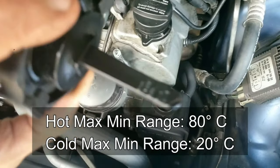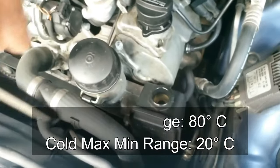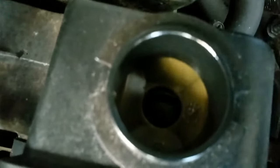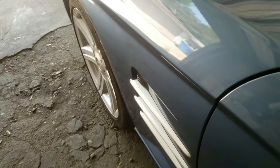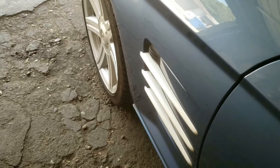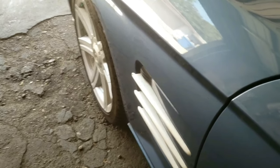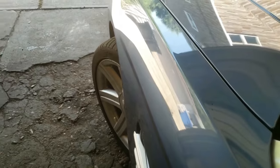First check your gauge and see if you are low, then add power steering oil and turn the tires to see if the bad sound or hard steering goes away, or if you have a leak. Do the simplest stuff first before removing any parts. This is the sound of bad power steering — it's worse when you apply pressure turning the steering wheel all the way in one direction. You also know there's a problem when it becomes very hard to steer or turn the wheel right or left.